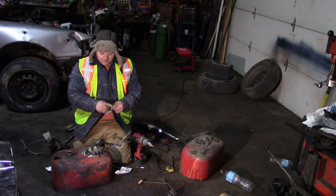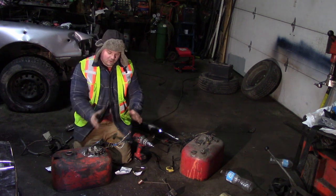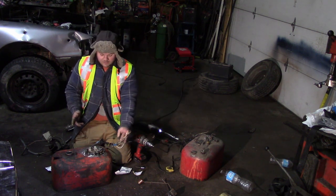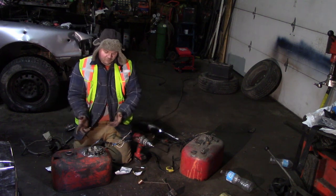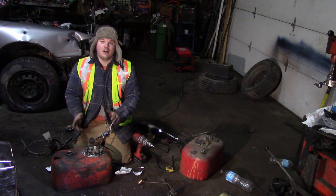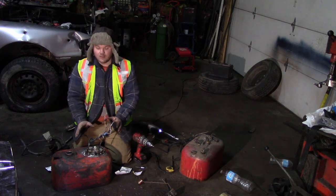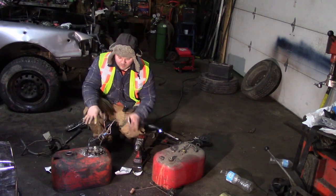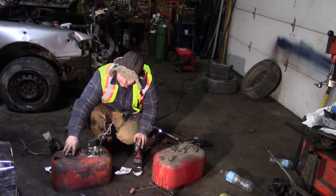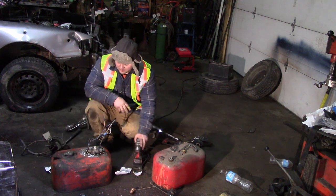As of right now, the only thing left to do to this derby tank is sort out the wires so we know which is positive and which is negative - with Camrys, the white is negative and the blue is positive for the fuel pump - and then remove the factory fuel line. We're not going to do that yet because keeping the line on will hold it out of the glue until it hardens. Now with this tank done, we're just going to put the cap on and pretty much just wait.